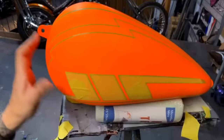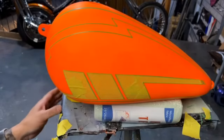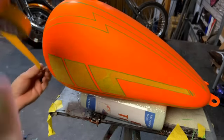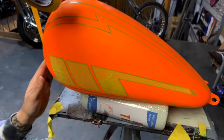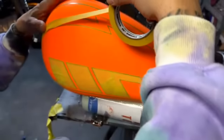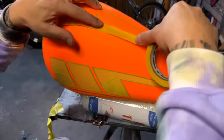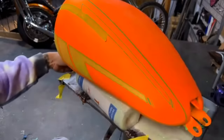Okay so you can see we have these all taped up — that looks good. Has anyone ever thought of doing a video on painting motorcycle cases or something similar? I haven't — nobody's ever asked me. But I'll keep that in mind. Seems pretty easy though — you definitely want to take them off, and if it's bare metal, epoxy primer is the way to go for the most corrosion resistance.